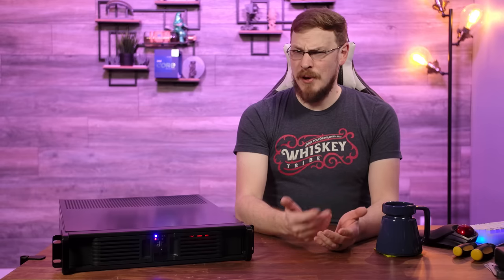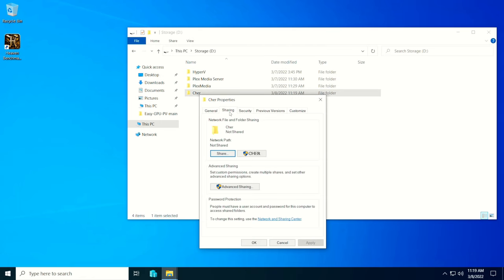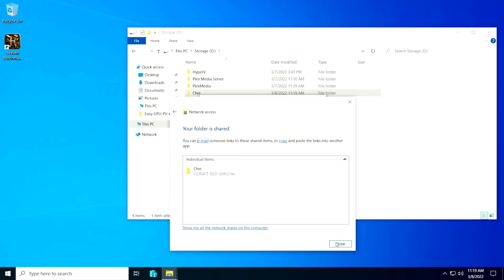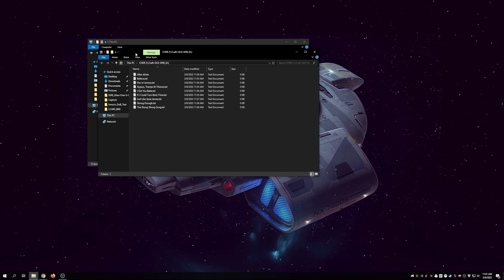Make sure if you start storing tons of data on these drives, you don't forget to back all of it up as well. Since you're most likely going to have other PCs on your network, setting this up as a file server is highly recommended. Luckily, there's a dead simple way of creating shares inside Windows. After creating the RAID storage volume, simply create a new folder named Share. Right-click on the Share folder, go to Properties, and navigate to the Sharing tab. At the top of the window, it should display the sharing status — in this case, the folder is not shared. Click the Share button — the other Share button. In the new window that pops up, give the share a name and select the users you'd like to give access to. Users are created locally on the Windows machine, so if you'd like to divvy out permissions to different people, you'll need to create a user on the Windows PC and assign permissions in this configuration window. This will create an SMB share, which nearly every operating system can connect to — a great way to store backups or centralized files you need across multiple devices.